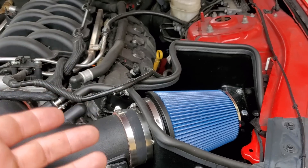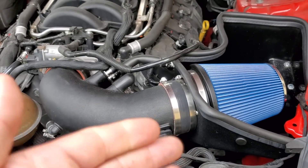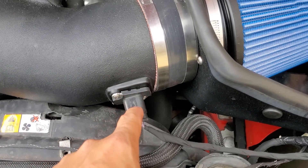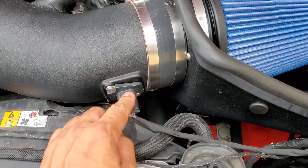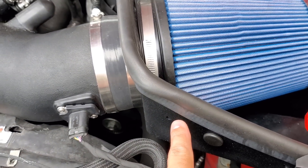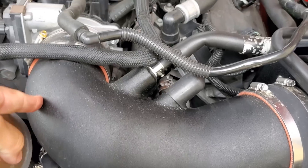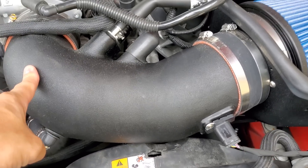Coyote swap guys love to make their own cold air intakes, and aftermarket tuners rely on data. If we don't have any data that tells us what the diameter is to make a proper MAF curve with it, we're going to have a lot of back and forth. MAF sensor placement is equally as crucial as the diameter of the housing it is sampling from. You cannot put the sensor in the middle of a turn, too close to the throttle body, or too close to the filter. It is crucial that it ends up in a spot with enough run to make a nice, clean sample size. A lot of people building turbo kits shove the sensor in a bad spot because it's easy — and once we see the placement, we say that's no good. Placement and housing size are both very important.